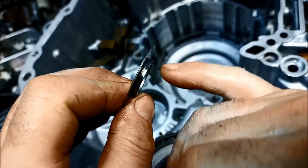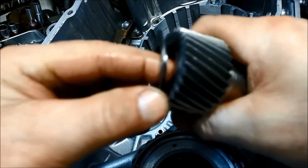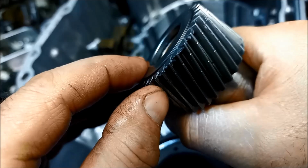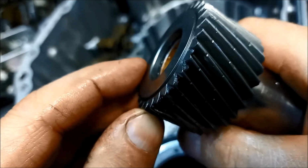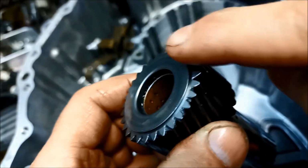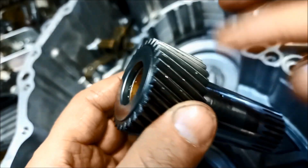It can't be too far out, or that skid plate won't sit flush on there. But you can have that bushing coming right up to that skid plate, and there's probably, I don't know if you can see that, it's probably about 2 mil. I can drive that bush in 2 mil, not as deep, and that'll still clear that skid plate.